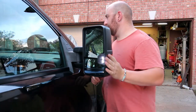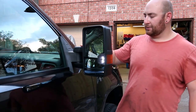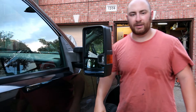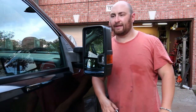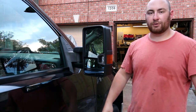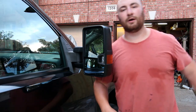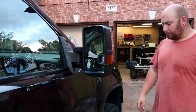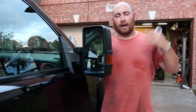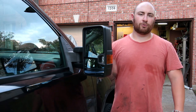Well there you have it. Installation is not too bad — total install time with all the custom wiring and everything was right around an hour to an hour and 15 minutes. They slide out manually and they feel really quality. The only thing I've noticed is this one sits at a slightly different angle than the driver side, but I took a look at pictures of OEM tow-haul trucks and they sit like that too — this side is angled slightly more in towards the body. They look really good from the front and side of the truck, and I do like the extra illumination and the ability to see everything both up and down. All in all for about $140 it's a worthwhile upgrade for me since I pull a lot of trailers. I'm Max, this is MaxWorks — thank you guys for watching, make sure to like, subscribe, leave me a comment and let me know what you think. More cool videos are on the way. Peace.